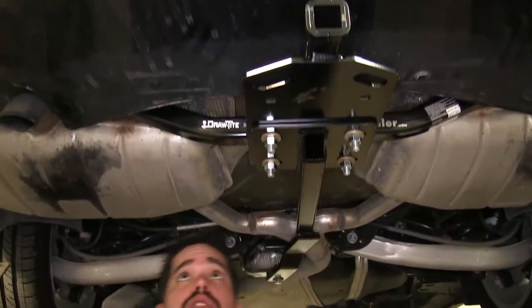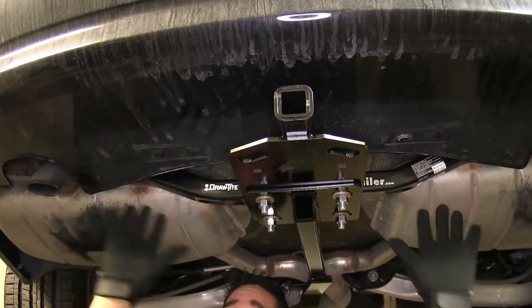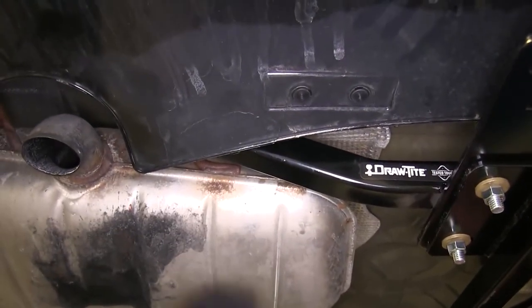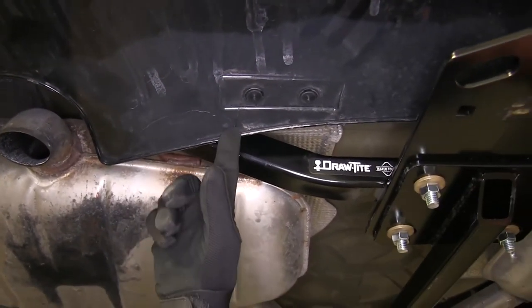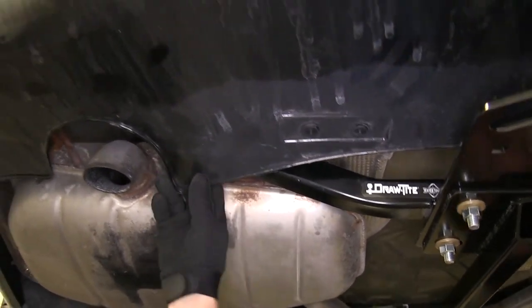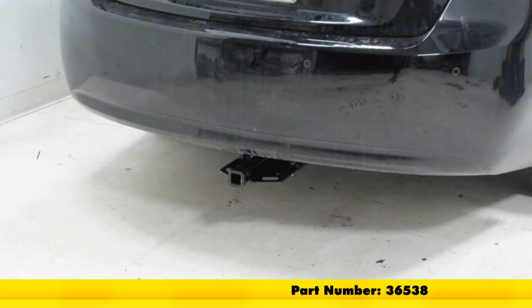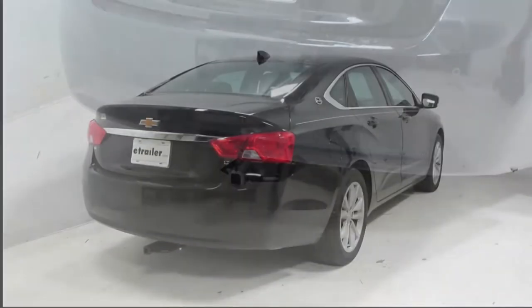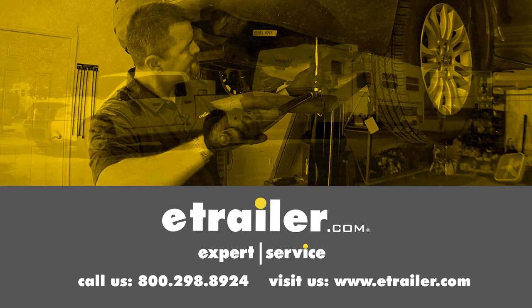As you can see, we have the hitch fully on. Right here you can see where it kind of bows out a little bit. It's not necessary to cut to get the hitch installed — we just bent it down a little bit. But if you want, you can cut right here and make a little relief for the hitch so it won't bow out like that. That'll finish up our installation of the Draw-Tite Custom Fit Class 2 Trailer Hitch Receiver, part number 36538, on our 2016 Chevy Impala. Click the link below to shop, learn more, or visit us at eTrailer.com.